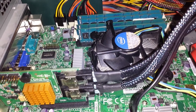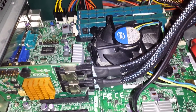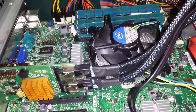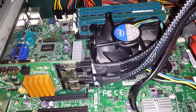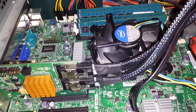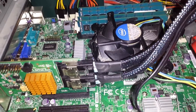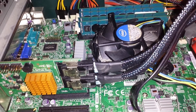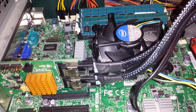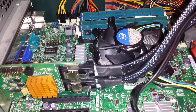Even when I did that it still wasn't working, so I had to wipe the sticky residue off. I guess that's what you get when you pay $260 and you're getting a deal on RAM — you accidentally leave part of a sticker on there. But once I got it all cleaned, it booted fine. I isolated it to that one stick because I was able to boot with one stick, then two and three, and once I had all four in it wasn't working whenever that one stick was inserted.